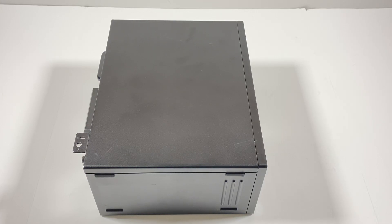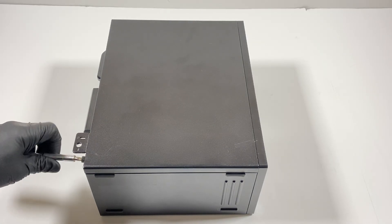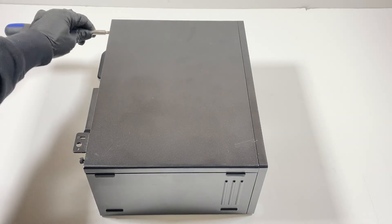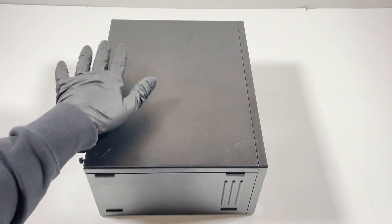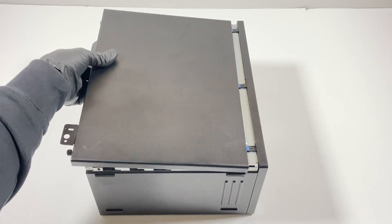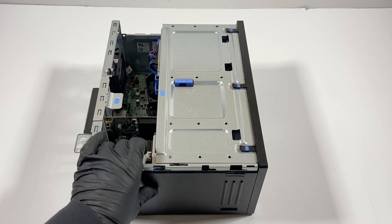What's going on you guys — I have another Dell Optiplex, this is a 3040, gonna be a teardown. I'm just gonna use the Phillips head, get the thumb screws in the back, slide it to the left, remove the side cover panel, and move the front cover bezel.